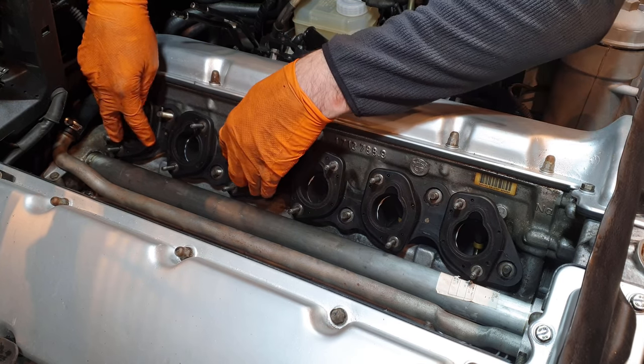This is my partially assembled pulley assembly with the tensioner and idler pulley. The bottom bolt screws into the block, then the last bolt gets tightened up — temporarily installed for now. With both left and right side tensioners installed, I finally get the correct 1119mm serpentine belt installed on the AC, water pump, and crank system on the right side of the engine. Everything's in the correct groove and I just need to set the tensioner at the bottom to the correct tension to tighten everything up.